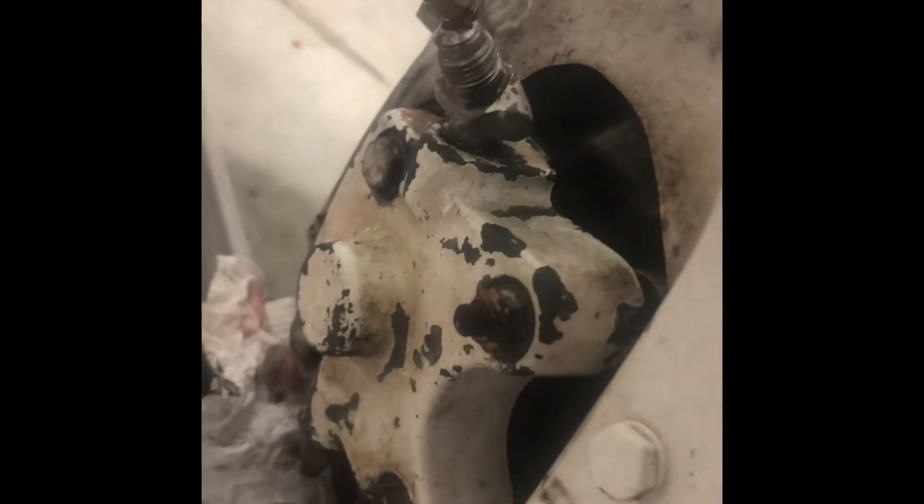Take an oil can filled with hydraulic fluid and squirt that in there to prime it, so we're not sitting there pumping on the brakes a bunch. Pre-fill it — you'll watch the fluid get drawn in, you can even see little bubbles come up. Once it gets full it won't take any more fluid, and you'll see the surface tension hold the hydraulic fluid right at the tip. Do that a couple times, then disconnect your cap, install the brake line.